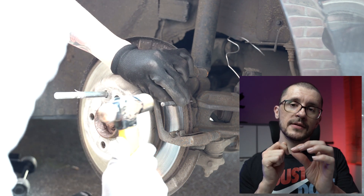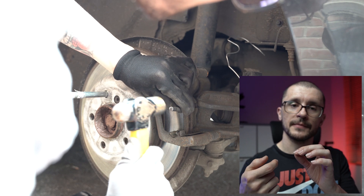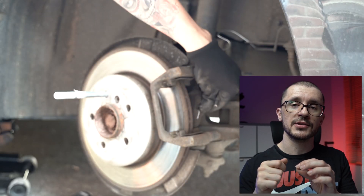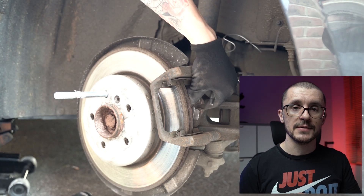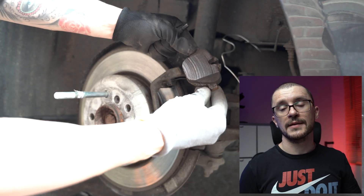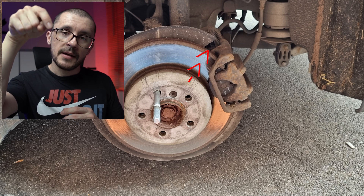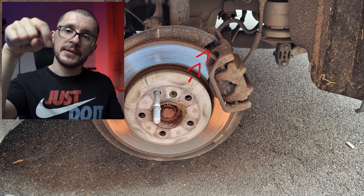Usually I take a tap and start knocking in different points to allow that pad to loosen up. I don't exaggerate in only one direction — I push it out, push it in, and allow it to get loosened up. Eventually the brake pad will allow us to remove it completely. This is where you can inspect what is happening on the interior of your disc. Another trick to diagnose if you're in this situation is, with the wheel on and providing you have wheels with enough space, you can put your finger between the metal housing and the brake caliper to feel the interior of your brake disc. Even if your brake disc is in good condition, I would still advise you to do this process to ensure your brake system stays in good health for longer.